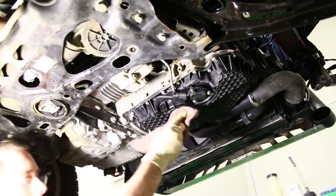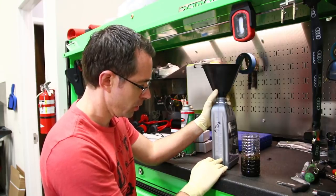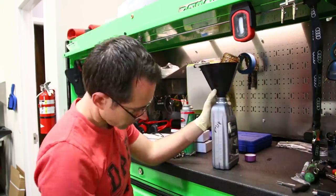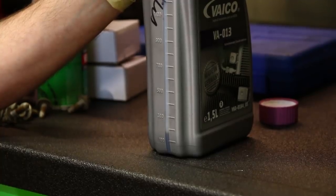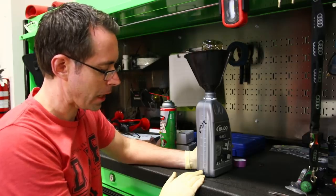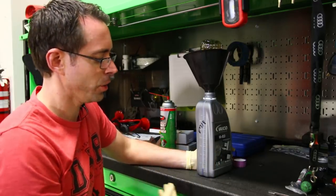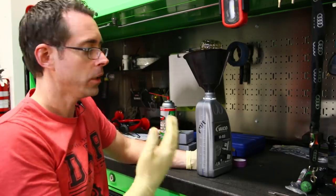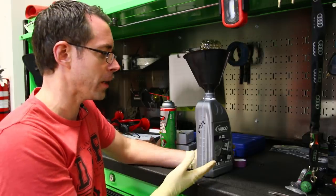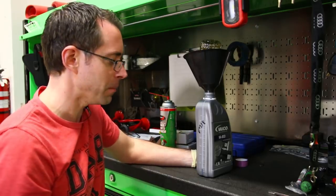Let's take a look at how much oil we got out from the bottom drain. We have an old coolant bottle to measure — it looks like it's roughly around 150 milliliters. So 150 milliliters is roughly about 0.159 quarts. We clearly haven't lost a lot from what we missed with the extractor. If you're changing oil regularly, that's not an amount I would personally worry about — you're going to be filtering and replacing it. As long as you're doing regular maintenance, that's a negligible amount. Either way is an option; some people only feel comfortable with one or the other, but we did not miss a significant amount of oil.